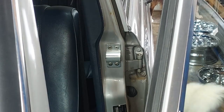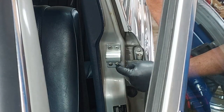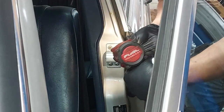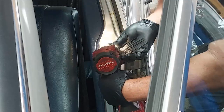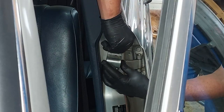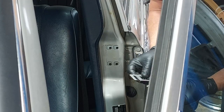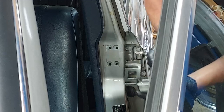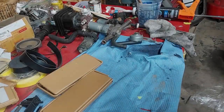You can see the striker assembly right there — four allen-head bolts. I use an impact to get it off because you don't want to strip these. When I take it off I can see there is one shim behind there, so I'll put that shim in the floorboard — that's how it goes.